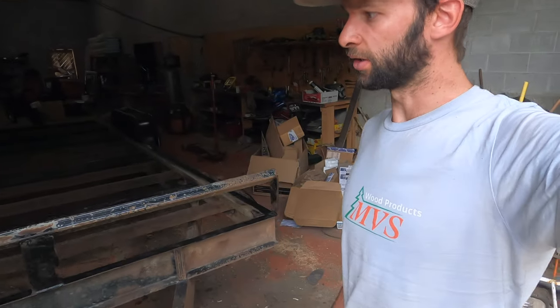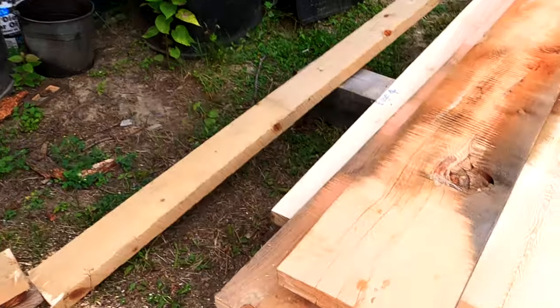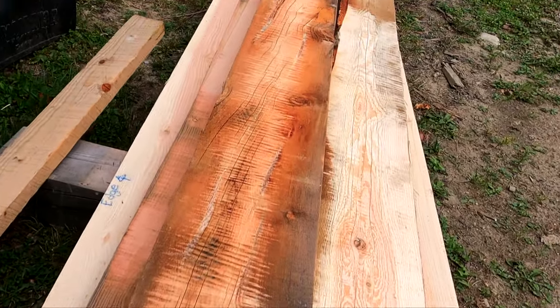To summarize, the main goal of redecking a trailer is just to strip it off and really try to reseal the steel. Minimum two coats — every coat you add is just another year or two in delaying the rust process. For the deck, I'll be using Douglas fir. Typically trailers use treated one-and-a-half by five-and-a-half, or like a two-by-six basically.